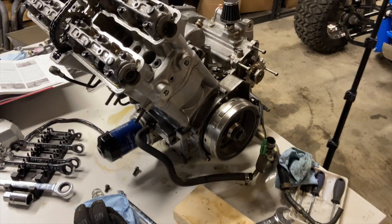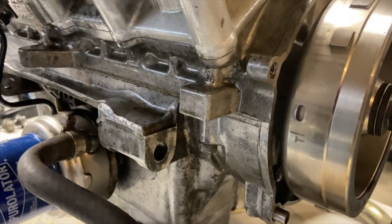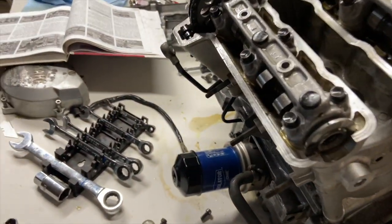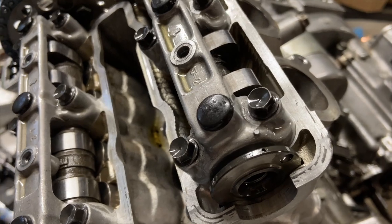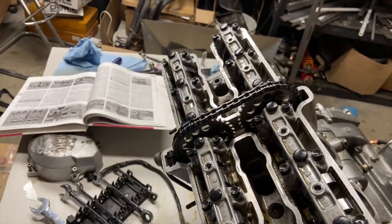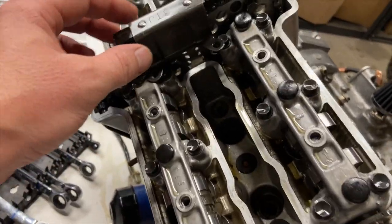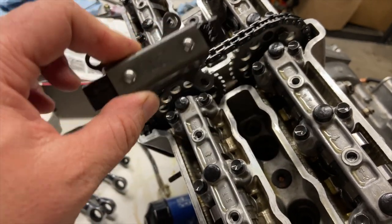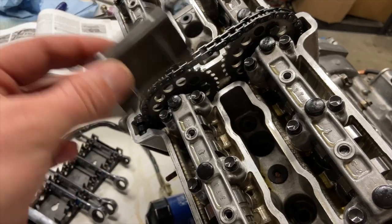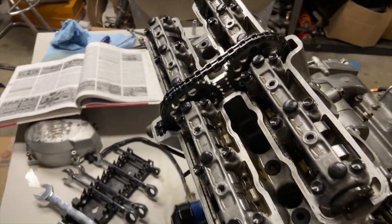Eight hours later. All right, so I moved it one tooth. Let's check our timing. It's top dead center. The exhaust cam lined up. The intake cam lined up. So now I'm just gonna torque all these. And I still have to put this little doomagigger on. I'll torque them all first because removing these inside four bolts is not gonna have a huge impact on this if all the rest of them are tight. Just my way of making sure the cams stay good.